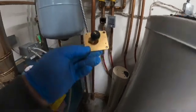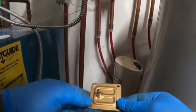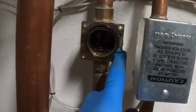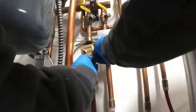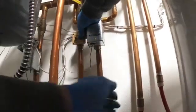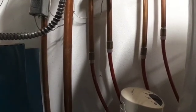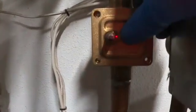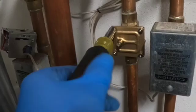Remember, one side of the valve has two dimples and the other side has one. You can't see it here on the top but you can see it on the bottom. It's very important that these two dimples go into the right side — there's a dimple there and above it, and then there's only one over on the other side. Set this in place and hold it with one hand. You'll notice one screw is smaller than the other at the base, and the valve body — one hole is larger at the top and one is smaller at the bottom, the other is opposite. Make sure you get the big one in the big spot and the small one in the small spot. Tighten them up across from each other in a star pattern.